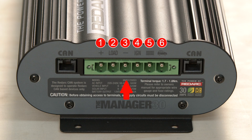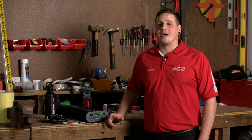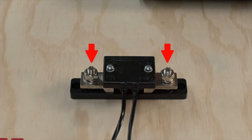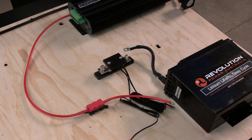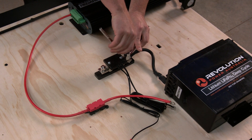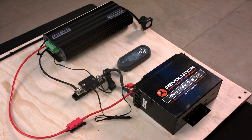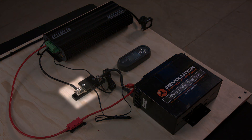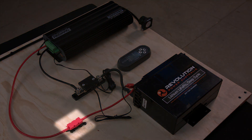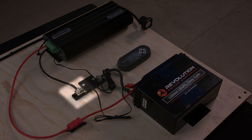Next up, the third terminal is your ground connection. Most importantly with this system, it reads all of the current to and from your auxiliary battery. The battery sensor is responsible for measuring any current going to or from your battery. It has two main terminals and two cables from a circuit on top. The terminals are labeled B neg for your battery negative connection and GND for ground. Connect the negative of your secondary battery terminal to the B neg side of the battery sensor, making sure the cable size is suitably rated for the total combined current of all your loads. Every other ground from a load or input, including the Manager30 itself, needs to be grounded to the GND side. For example, if you have an LED light, the positive goes through a fused circuit from your auxiliary battery and the negative of that LED comes back to this GND or common ground side of the sensor.